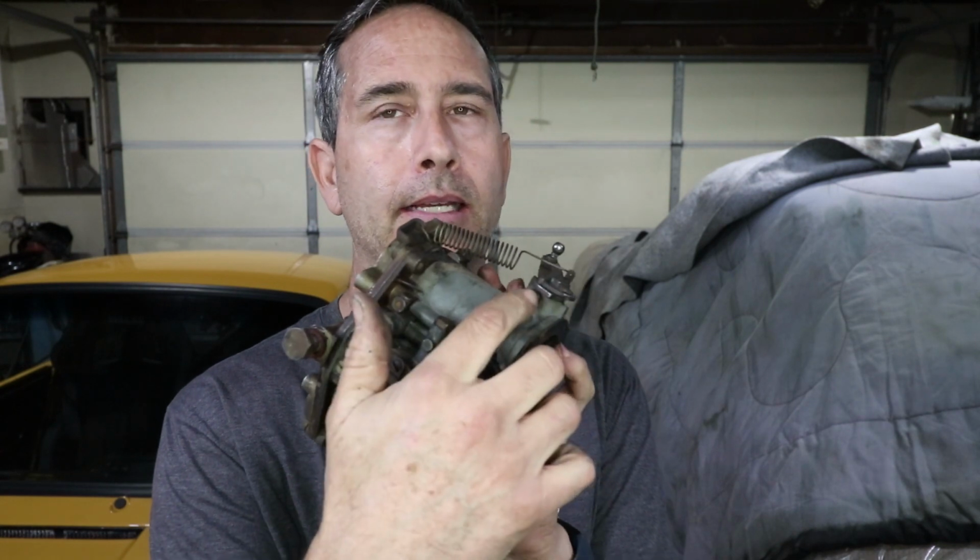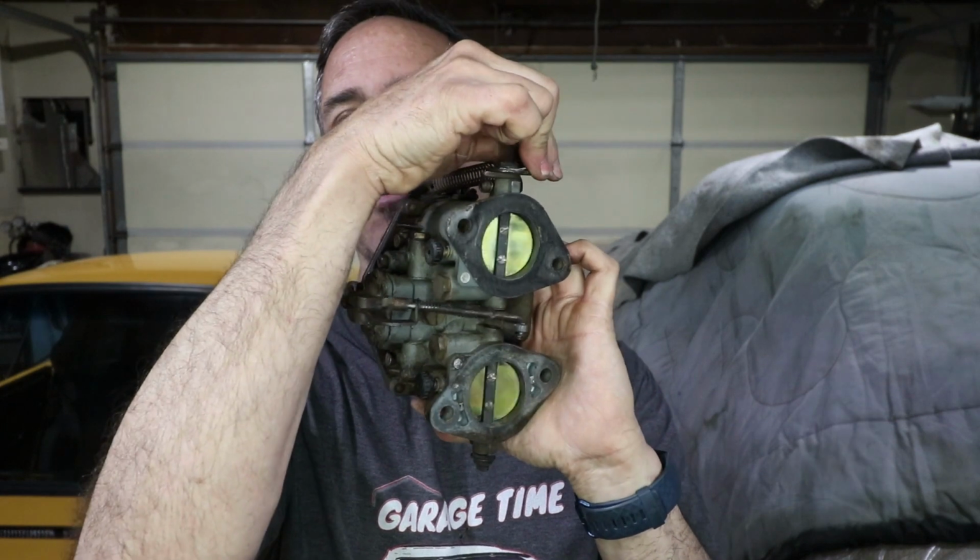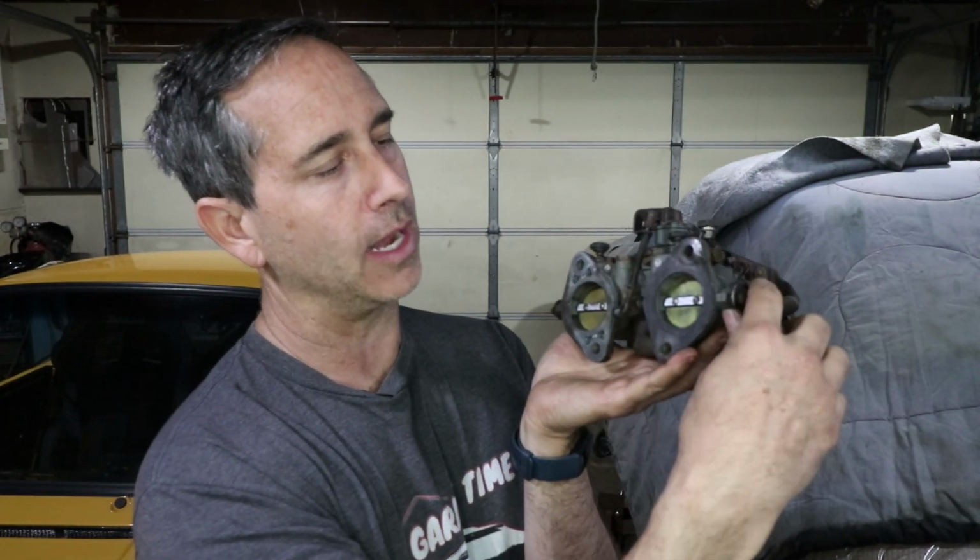The other important adjustment, and I think this was a big one on the way my carburetor was originally set up, is on this carburetor. It looks a little different, but this is the idle speed screw on the lever that actuates these throttle plates. The way this was set up when someone else put the carburetors on was 3 turns in from the valves being closed. These butterfly valves will come to a rest position almost touching the bores, and it basically just covers up that last hole on the transition port. That's how it should be.